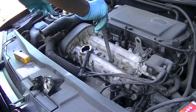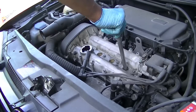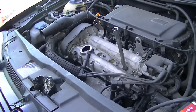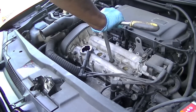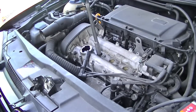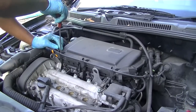Spark plugs are very responsible for how economically your car runs, so it's important to get these right. When putting them back in, insert by hand and tighten by hand — it's impossible to cross-thread it doing it this way. I've cross-threaded before and it's an expensive, annoying procedure. Once hand-tight, just get a ratchet and neatly tighten it. You're supposed to do this to torque spec, but I'm using experience here as I didn't have a torque wrench to hand.